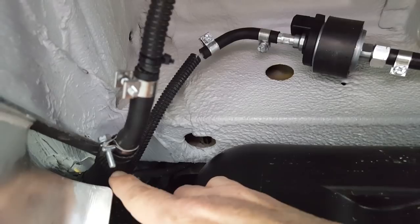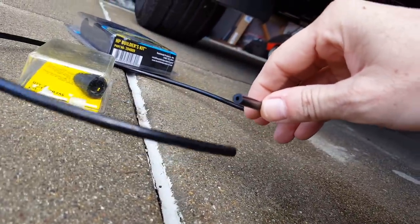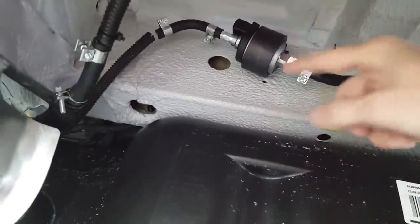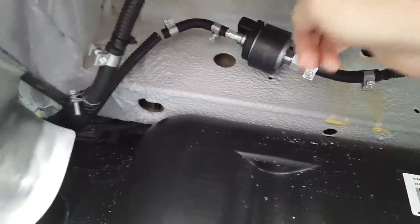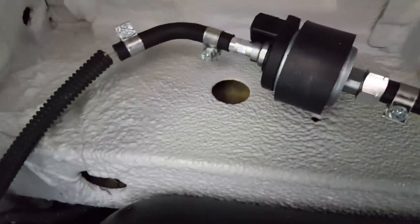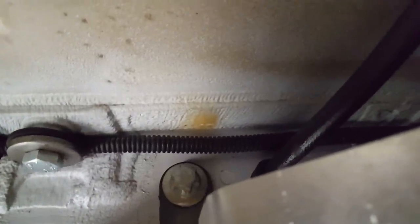So I went from that Dorman connector to a section of hose, and then underneath this wire loom is thicker black tubing, this stuff that came with the Espar kit. So that goes into the intake of the dosing pump. This is supposed to be mounted at an angle that's at least 15 degrees up, with the electrical connection pointing up. So then I went into another piece of adapter tubing, and then it goes to the smaller clear plastic tubing that came with the Espar kit. So that runs from the pump, goes up and over the fuel tank, and again it's in wiring loom. That's just to protect it, but that is fuel line inside there.